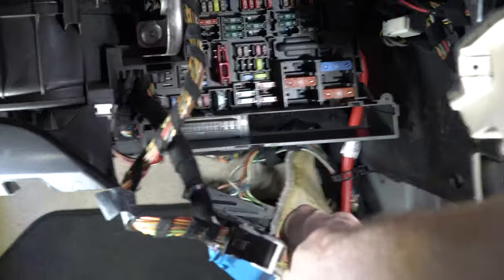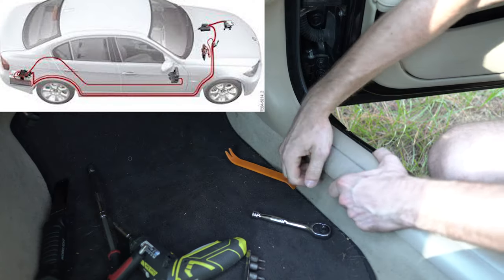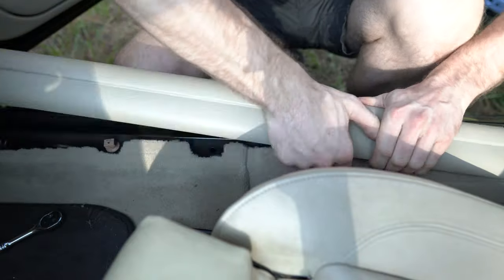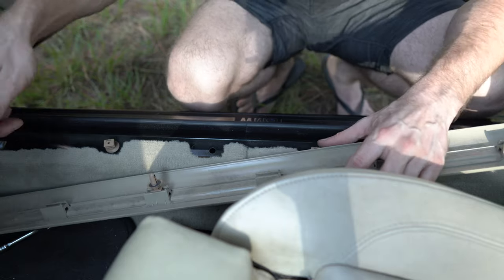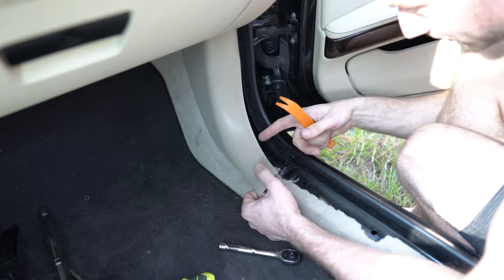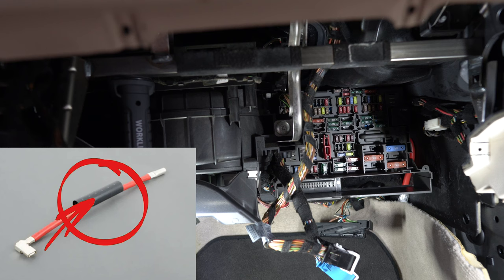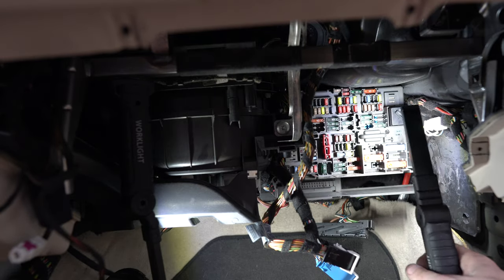Now to the most important part — the fuse box itself. But before we go too far, let's check the B plus wire. You can see if it's been replaced, and if you're replacing it you'll need to remove some trim pieces. For the door step, simply start pulling it up from the corner — some clips will stay on the body of the car so be careful. I'll add those types of rivets in the description in case you break them. Then the L-shaped piece of plastic — same way, just pull it. Now roll the carpet back and see if you have a black shrink wrap on the red wire. If it looks like mine, that means the wire was replaced by the dealership or a previous owner.